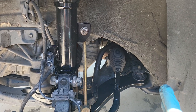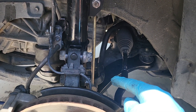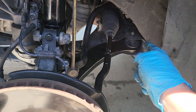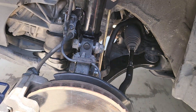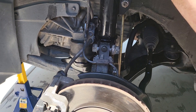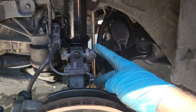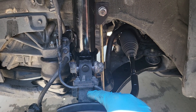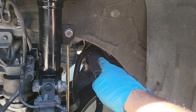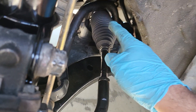All together this probably cost about five to six hundred dollars for the entire front end — motor mounts complete set, both left and right control arms, left and right inner and outer tie rod ends with lower ball joint and bushings. Pretty much a whole front end with motor mount set for about five hundred bucks shipped. I spent maybe three or four hours last night tearing it all apart — three bolts there, two bolts here attaching to the lower control arm, then the brake line disconnect and the sway bar disconnect, which was kind of hard to get to.